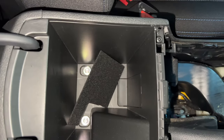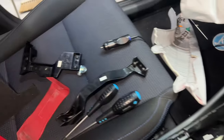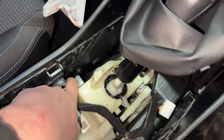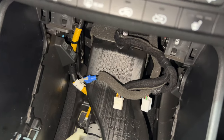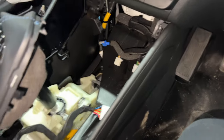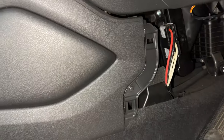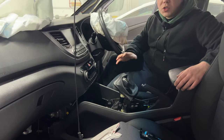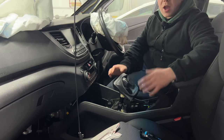I'll quickly remove all of them and then show you where there are also two more hidden away. On this one you actually have two screws on this side and three on this side, and that front bracket was two screws either side — just Phillips screws. The remaining hidden ones: if you see this side panel just here, this one literally just carefully pulls away as it's on trim clips. That exposes one more Phillips screw, and it's the same for the passenger side. Once you've undone all those screws, that centre console will now pull away from the vehicle.